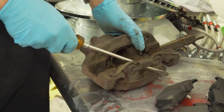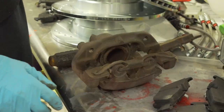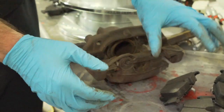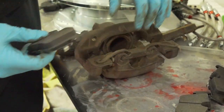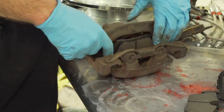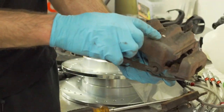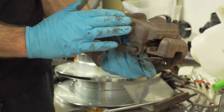The piston side is the side with the clip — make sure you note that. You can pop the clip out, though I'm going to leave mine in since my cheap brake pads didn't come with a new one. You screw the knob in and that pushes the piston inward, allowing room for the new pad and material with the new rotors. Throw the new pads in, make sure the direction is correct. I'll throw a little lube on each corner so they can slide over time, and clean things up with a little brake clean.